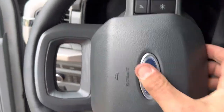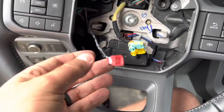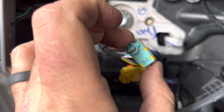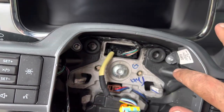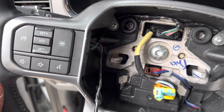Once you get that to pop out on each side, this panel will come out and we can disconnect the connectors. Those little orange pieces — take a little flathead screwdriver, pop them out a bit, then the yellow pieces will pop out as well. There's also a red tab up here to disconnect. To get these buttons off, we need to undo these two Torx screws — I believe it's T20. This part down here is held in with push pins, so pull that out gently.